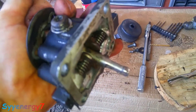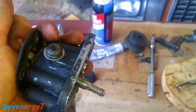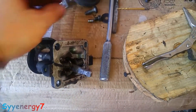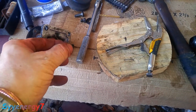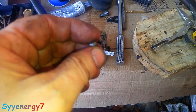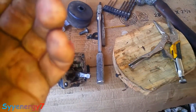I was driving home Friday from Fanning Springs and I couldn't get it into overdrive. Right before that, the shifter was real sloppy. This pin was not falling down into the housing — sometimes they fall down into the housing and you've got to take this off and fish it out with a magnet. It was actually stuck in there, and I had to use a little punch to knock it through to get it out.